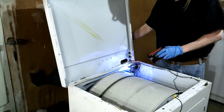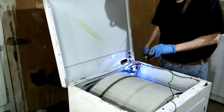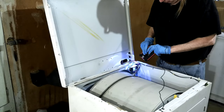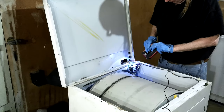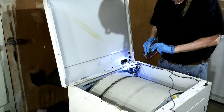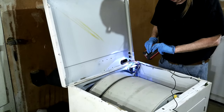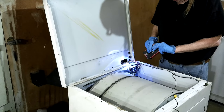If you manually turn the timer to off, or if you leave it, it still turns itself to off. But it hasn't been heating — they've been trying to dry clothes all day and it hadn't heated for the longest time. It'd take two hours to dry a big load of clothes, but it should take 45–50 minutes, maybe an hour and 10 minutes for a huge load.